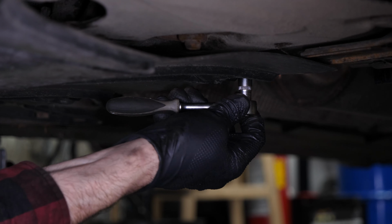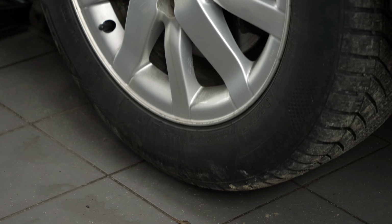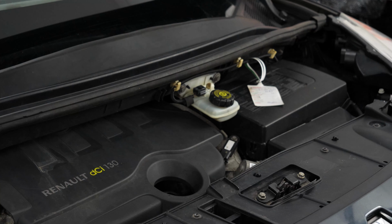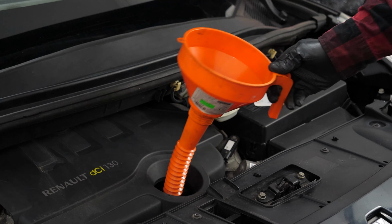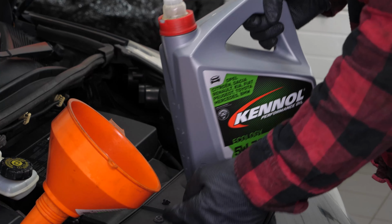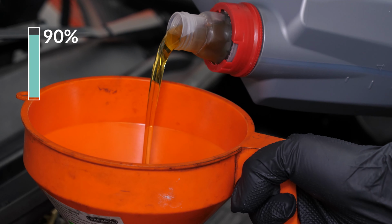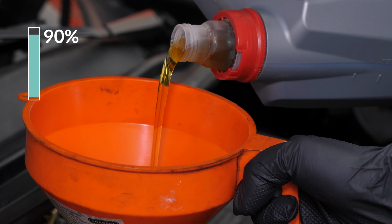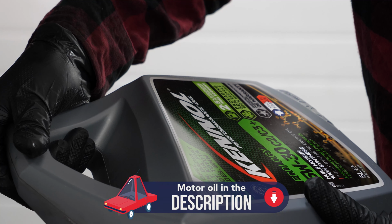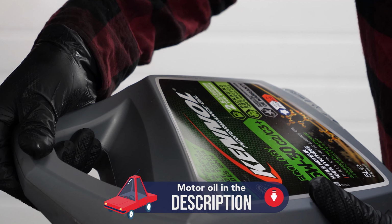Firstly, put the crankcase back in place, then lower the car back on the ground and check the oil level. This is something that can only be done when the vehicle is flat. Begin by putting 90% of the suggested amount. This will leave you a large enough margin to adjust the level of oil appropriately. You can find the exact amount of oil suggested for your car in the description of the tutorial.